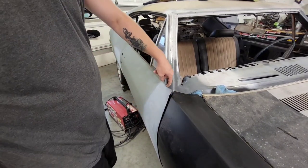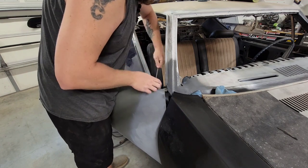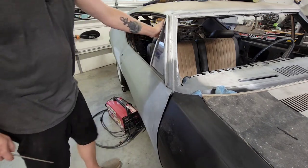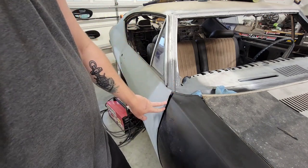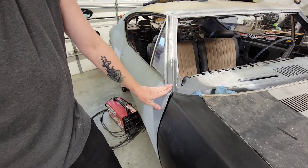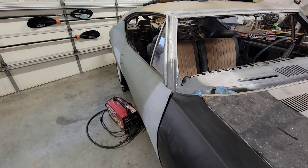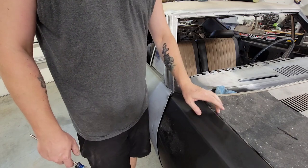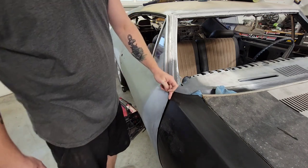And I have a little piece of the door here that hits - that explains why that's making contact. I have a little bit of room to move in this way. I may loosen these bolts and try to push the door in, tighten up this gap. It may also want to drop down some, but looking at my gaps I don't need that. So somehow this fender needs to come up. I just can't push this fender back anymore, which is what I would need to bring this gap closed.